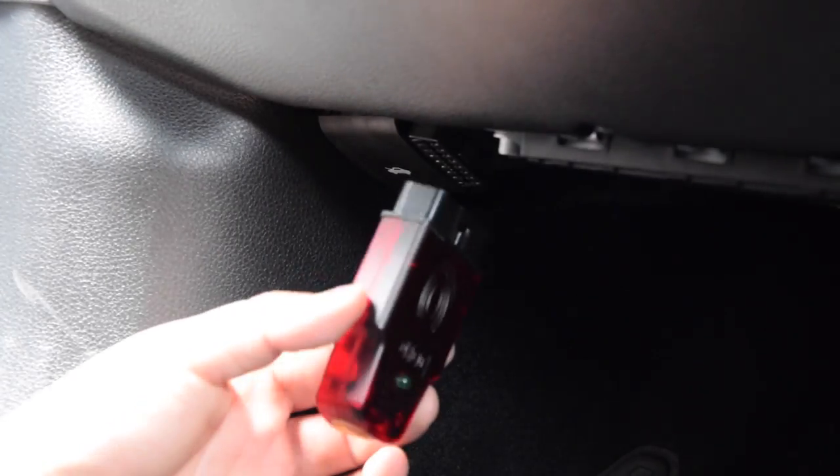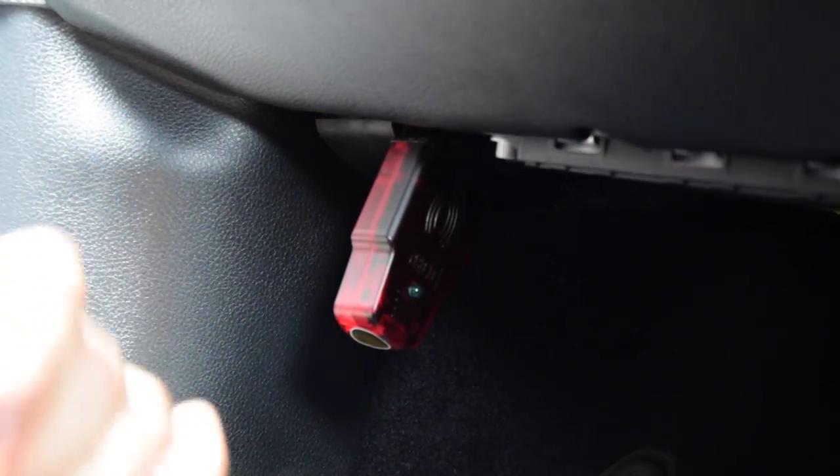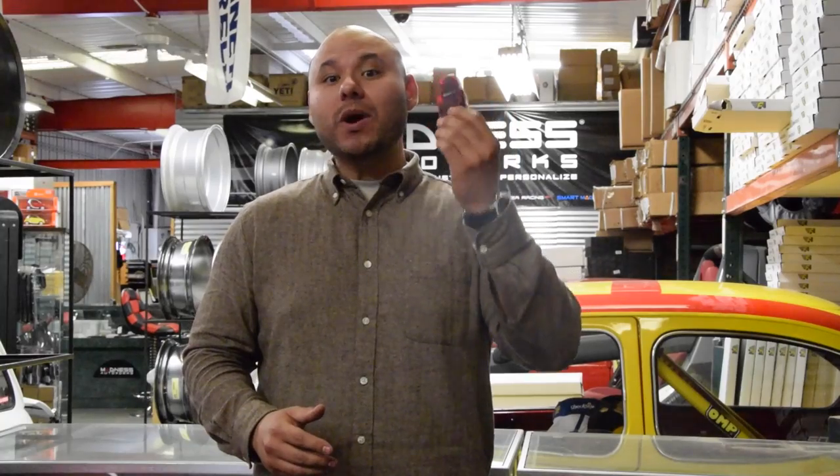Because this product marries to your VIN — when you plug this in, it writes to the car and saves the VIN number to the unit — it's something you can use forever, anytime you want to plug it in and re-flash. For instance, if you go to the dealer and they do a software update — that happens a lot; you go in for routine maintenance and there's a software update — they'll go ahead and update your software without you knowing. You get a printout that says you had a software update, and you're going to get in, step on the throttle, and be like, wait a minute, something's different. You'll read over that paperwork and say they flashed my car. Well, what happened was when they flashed your car, this went away. But the beauty is all you do is take it out of your glove box, plug it back in, turn the key on, and it will reprogram the transmission control module — the tune is applied and ready to go.